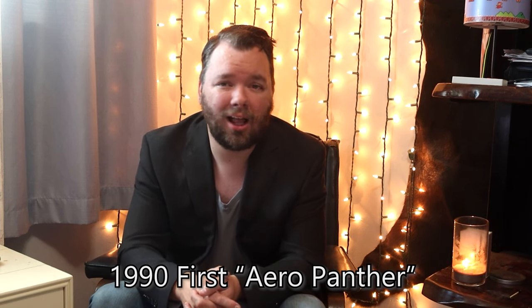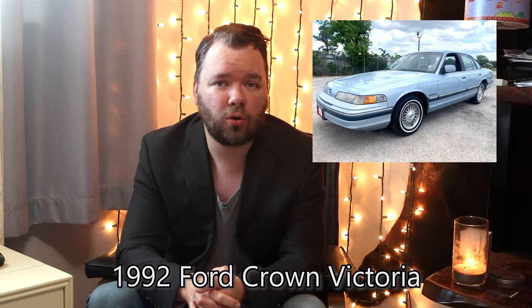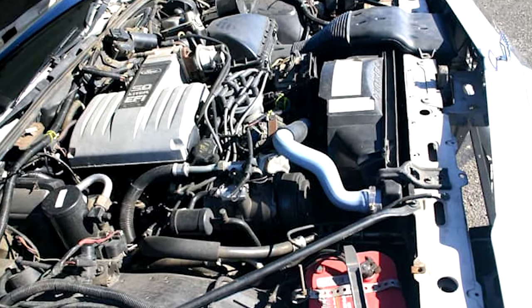In 1990, Ford started revising its Panther chassis cars into the aero body style, first with the 1990 Lincoln Town Car, and then in 1992 with the Crown Victoria and Mercury Grand Marquis. The Panther chassis dropped all coupe and wagon options from 1990 forward. A major change was the replacement of the 5-liter motor. The first to get the new 4.6 overhead cam was the Lincoln Town Car. That old 140-horsepower 5-liter V8 was not fit for any sort of performance. The new overhead cam 4.6 had 190 horsepower, and this motor was dubbed the modular 2-valve. There's a link in the description — I made a video on that too.